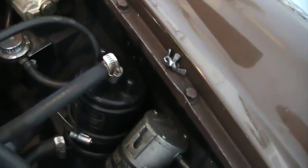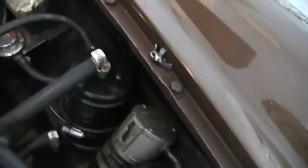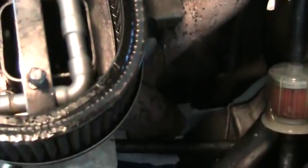That's probably the best investment I've put in this car. I paid $107 for the other separator canister. Add the two of them together and divide it out — I came out okay. Now let's follow the hose that came out of the charcoal canister — it went up to the carburetor. I'm going to pull the cap off the carburetor. Are you ready for a real treat? See that pipe in there? Look at that — going down into the throat of the carburetor. This needs some explanation.